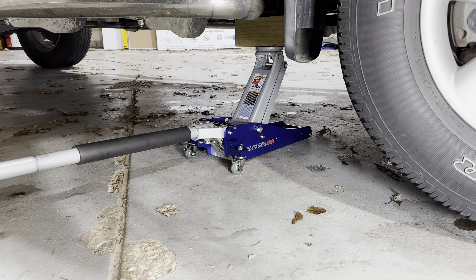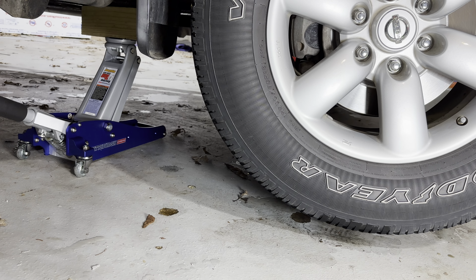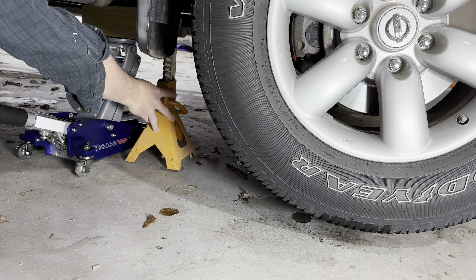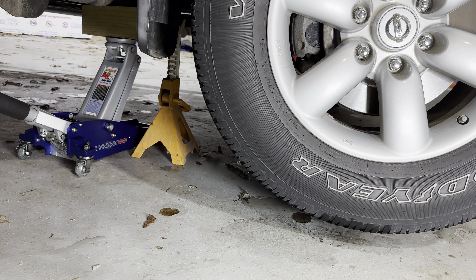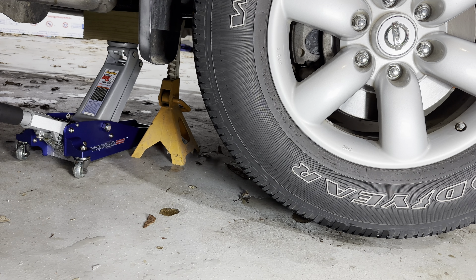It's light and compact and safer than the truck jack that comes with the truck. It raises the truck off the ground easily and with a couple inches to spare. When we take this tire off, we'll throw a Harbor Freight jack stand underneath here — you should always be using some sort of jack stand or secondary blocking under the frame of the vehicle when you're going to be working on it, whether you're under it or not.